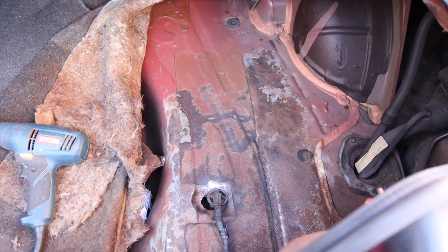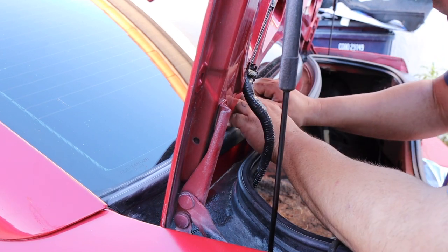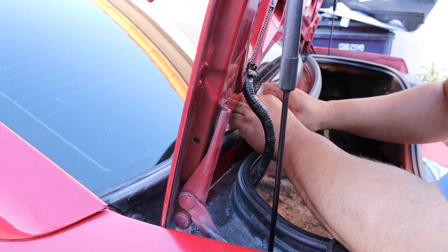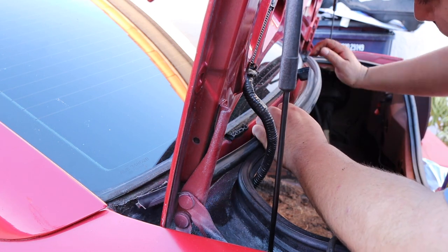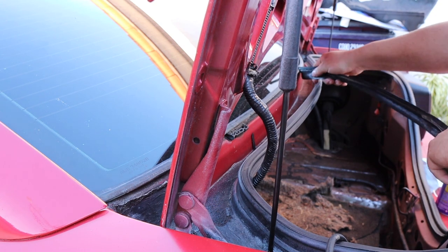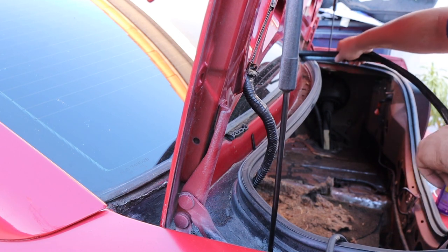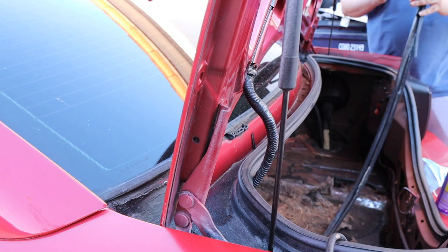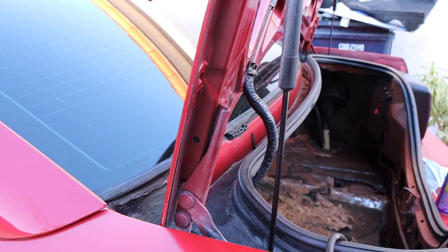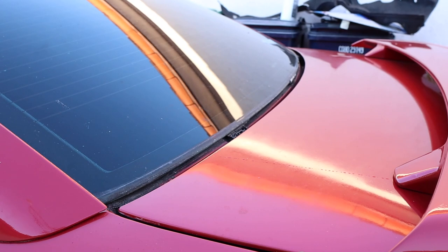POR-15 should be here on Friday, but we're going to go ahead and knock out the molding now. For the molding, we're just going to pull forward and kind of pull backwards to get it out of there. As you can see this one is coming apart. You can see how it had even some water in there just getting in there — this is all breaking apart. If you got a molding like this you need to replace this ASAP. American Muscle will supply you with the molding. This is pretty much how that molding came out — all broken up. I've got Super Clean right here which I'm going to hit all that with, clean everything up, and then hopefully install the new one with no problem.